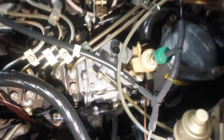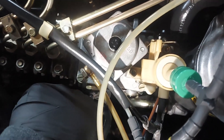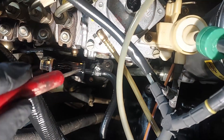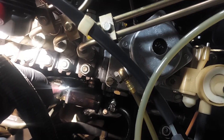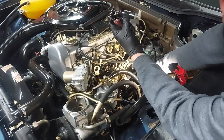Changing the pre-filter is pretty easy. There's a Phillips head screw right there and another one right behind. We're just loosening both Phillips head clamps, and then we can pull that filter right off. There we go — we got that nasty old filter off.